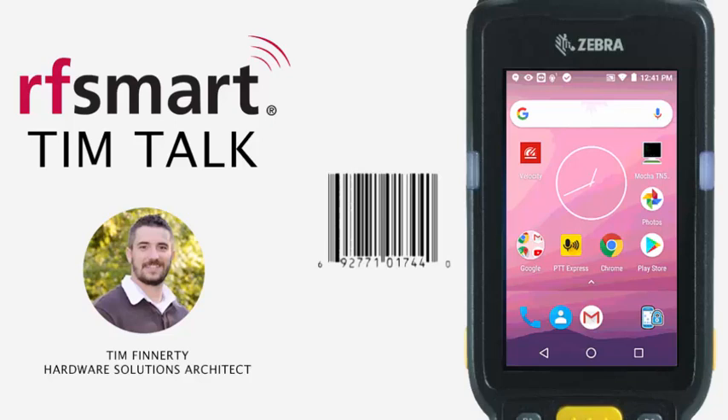You can see that I have a barcode over here on the left and this is a standard UPCA barcode. On the far left you can see that there's a six and on the far right there's a zero that are kind of not a part of this middle SKU number here. The one on the left is the number system and the one on the right is the check digit. A lot of times these devices out of the box are not configured to read either the number system or the check digit, so they'll just capture from the nine all the way to the four and leave off the two digits at the end.